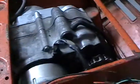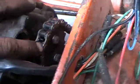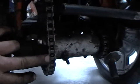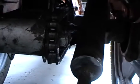The drive is taken from the original Honda sprocket. There's a 17-tooth sprocket here. Going down, excuse me while I lay on the floor, to the original BSA drive through the layshaft and a secondary set of gears back to the original drive of the wheel.